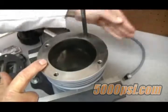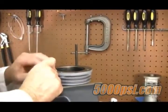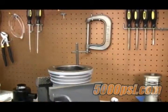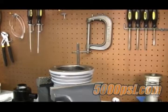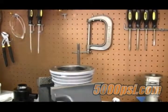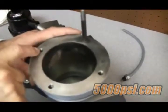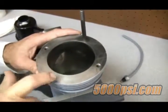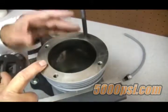Now that we have the cylinder head off, let's rotate the flywheel so that the piston goes all the way down to the bottom of stroke, and we can inspect all the way down into the cylinder, making sure there are no score marks or damage. Excessive wear might be cause for more extensive repairs. Let's have a look at the head bolt holes as well, ensuring the threads are intact and not pulled — sometimes repairs can be made using a thread insert.